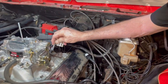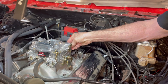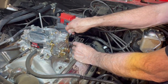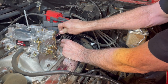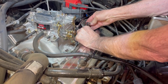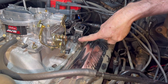So what we do is stick this on here real quick. We notice our angle looks pretty good, so we get this all tightened up right here, stick our nut on right here and tighten it down. Now even though you get all this welded up, you might have to bend it to your liking — perfect alignment is a dead pull. So we're going to stick our detent cable through here, clip it in, and then clip it onto our attachment anchor right here that we just put on the carburetor. It clips on — now we have a dead pull right there.